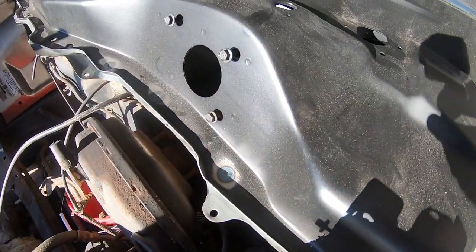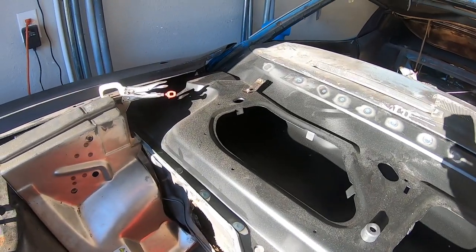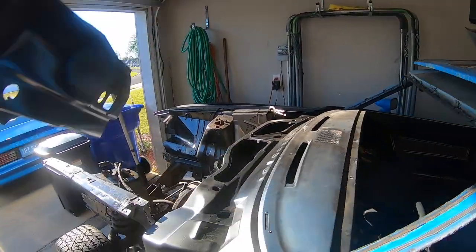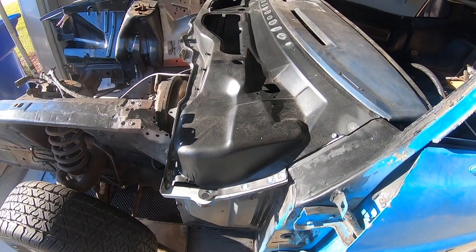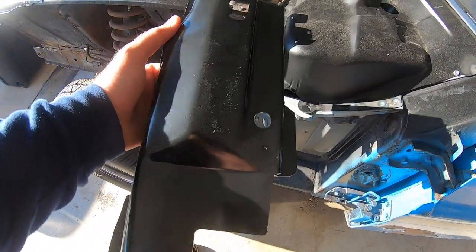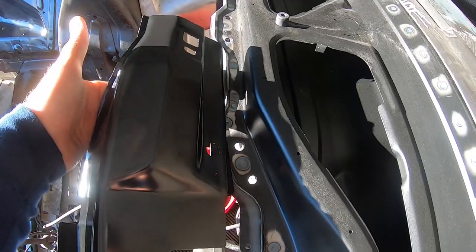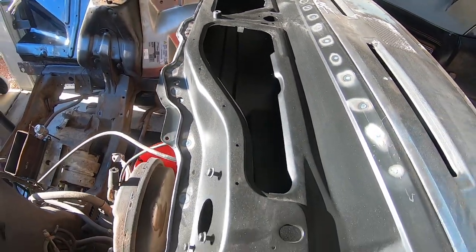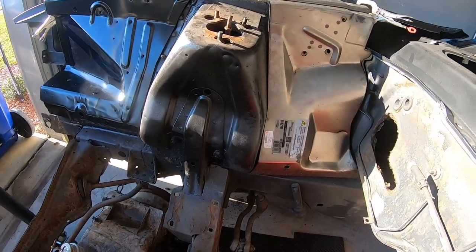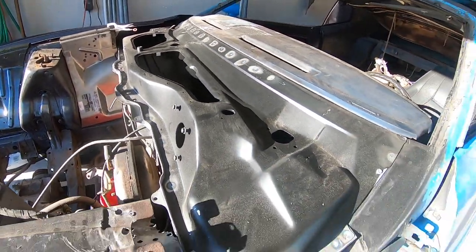Spot welds look good. As you guys saw before, we plug welded the lower cowl to the firewall area. I know that is pretty. So you can get a side-by-side difference. This is what the panels come looking like. This kind of glossy, it's got some kind of paint type of material on here. But as you can see in comparison, this satin black, street rod black, to me, looks more true to the original than this here. And you can see on the shock towers, that's an epoxy primer. I used to think that looked pretty good. But after spraying this, there's no comparison. This is much better.